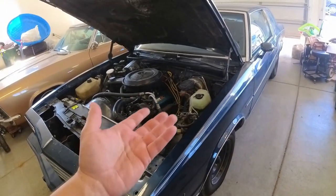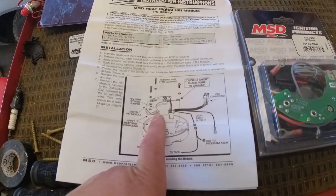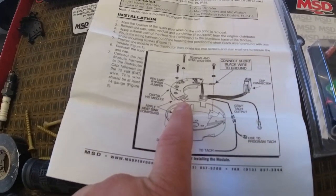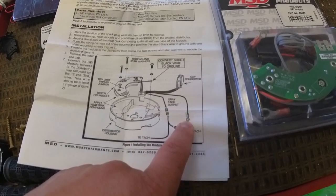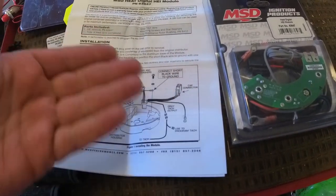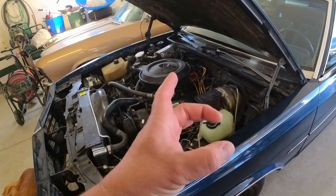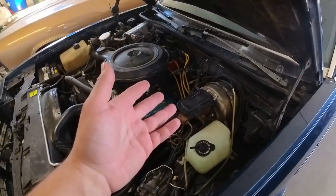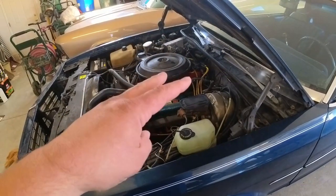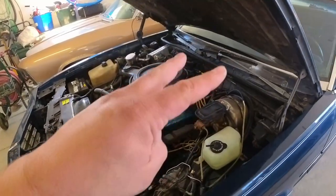This car never gets driven hard enough to need the rev limiter — it's just a smooth 350 cruiser. The basic premise is you take the old module out, put this one in, your mag pickup plugs in, you've got the distributor cap connection as always, and a ground. An extra ground makes a lot of good sense so everything works like it's supposed to. That avoids any grounding issues at the distributor — sometimes there's a gasket at the base of the distributor to the intake manifold, the mounting foot may be painted or dirty, so that's not necessarily a reliable ground.